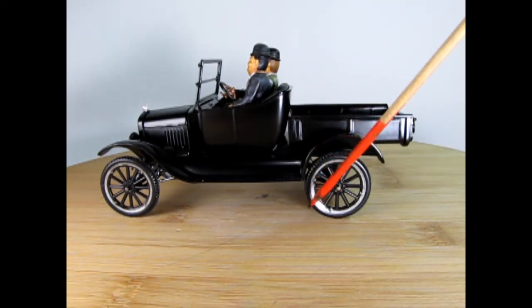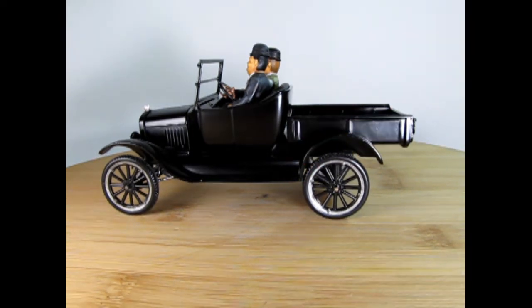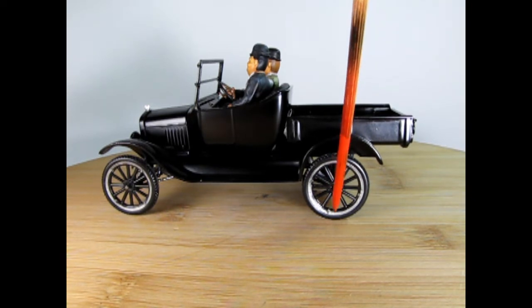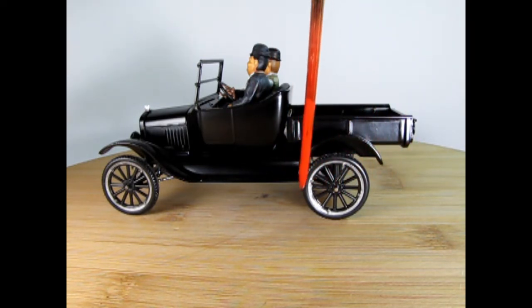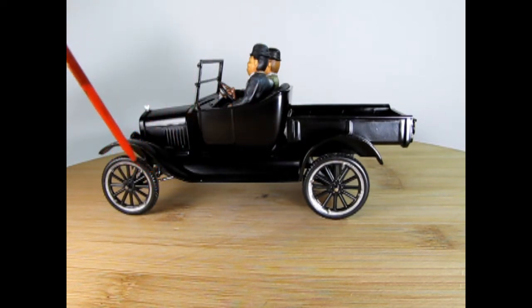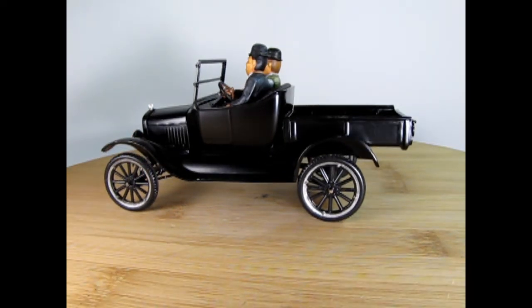See how close my rear tire is to the fender? That's actually how they're supposed to go on the real Model Ts. Like I was saying in the previous video, this axle goes straight up and down when it hits a bump — it doesn't turn or anything, so this little area here will not get hit by the tire. Whereas in the front you do need the space because those wheels are turning, so if it's too close it's going to scrape on the bottom or front of the fender.